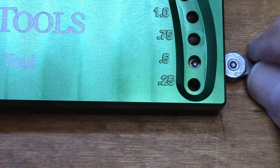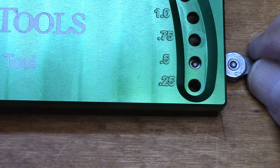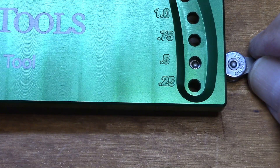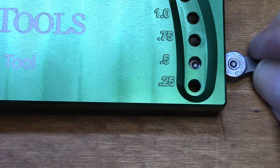This is another chain. On this particular chain, the pin lines up at the 0.5% mark. If you're dealing with an 11 or 12-speed chain, you want to replace it at this point.